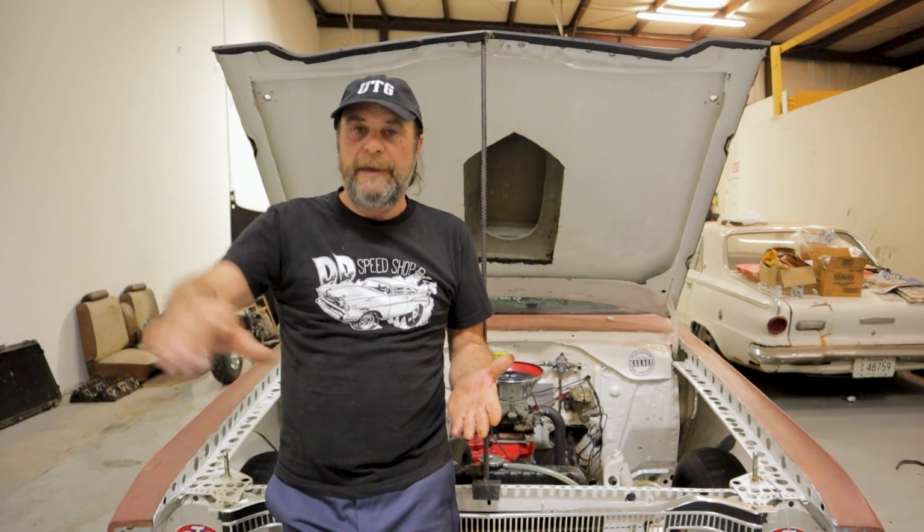So let's recap. The first time I took the car out, it felt staticky, like it wasn't pulling cleanly. It didn't sound clean. And I interpreted it as an ignition issue. So we came back and we went through the distributor, we went through a few different things. And sure enough, that was it. That cleared it up. Now the car doesn't feel staticky at all. It feels clean and smooth, but still not making any power. Now, by fixing the ignition issues, we picked up a full half-second ET, but nothing off the 60 foot. The 60 foot stayed the same, 206, really slow. And it doesn't really make the power that I expected, that I wanted, upstairs.